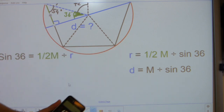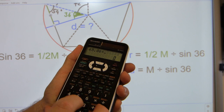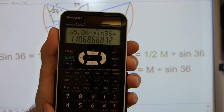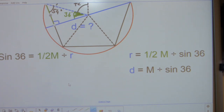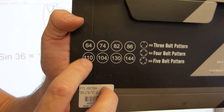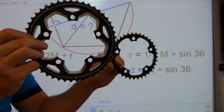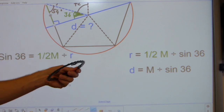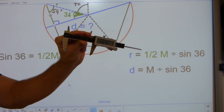Entering the full measurement of 65.06 and dividing by sine 36, the result is 110.68 millimeters pitch circle diameter — or bolt circle diameter. Nobody makes a 110.68 pitch circle, but they do make a 110 millimeter bolt circle. The small discrepancy is due to measurement error from eyeballing — these chain rings are made to fit a 110 BCD bolt circle diameter pattern.